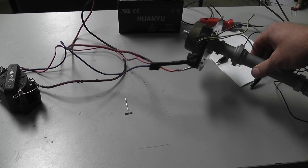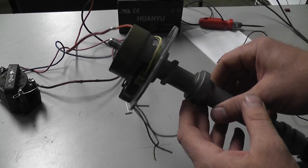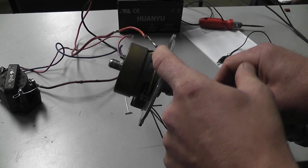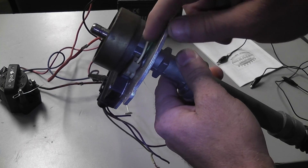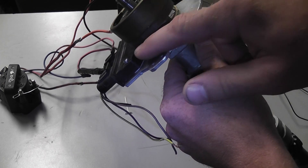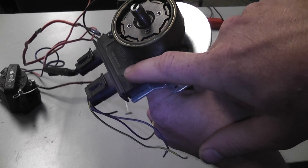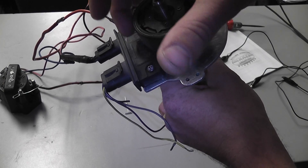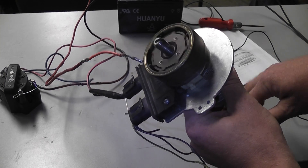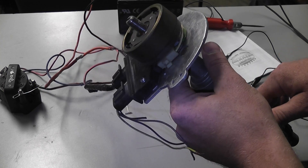What's inside of this distributor is a pickup coil, and that is this two-wire component on the back inside of here. So this pickup coil right here where the two wires go in is triggering this ignition module. It sends an AC sine wave in, the module converts it analog to digital, and then uses that signal to control the transistor that's going to turn that coil on and off. Motion, magnet, conductor — and it makes its own voltage.